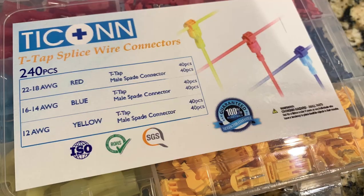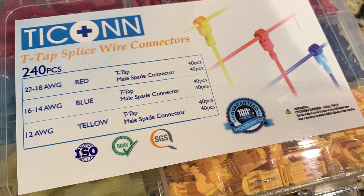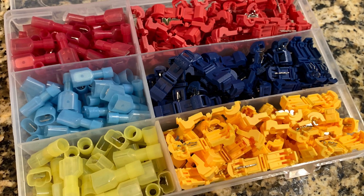Anywhere there was a system that was going to prevent the bus from starting, just ground it — safely, with wire nuts and things like that. But never, ever, ever twist wires together and put electrical tape over it. That is so bad. Use butt splices, wire nuts, and make sure those are taped up. Just complete the circuit. As soon as you complete the circuit, your fuse box doesn't know it's not hooked to that window latch anymore. Just complete the loop, ground it, and you're done. Your bus will crank up and won't know the difference, and you won't have an extra 75 million feet of wire.